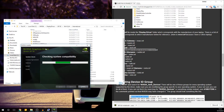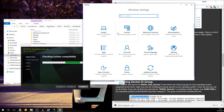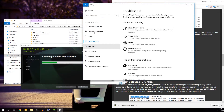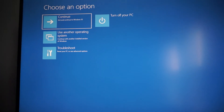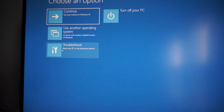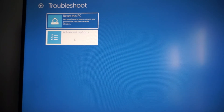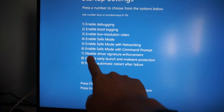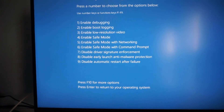What you need to do is go to System Settings, click Update and Security, then click Recovery. You will see Advanced Startup — click Restart. Since the computer is in BIOS-like mode, I have to use my camera to point at the screen. Click Troubleshoot, then Advanced Options, then Startup Settings. Click Restart and you will see the startup settings list. You want to select 'Disable Driver Signature Enforcement' — click number 7.